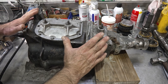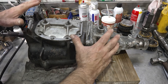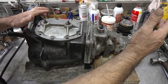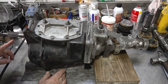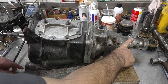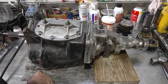What we want to do is convert this over to a late model Super T10 gear train inside using a special adapter main shaft so that we can utilize all the exact pieces of this. I'm going to change the case to a later model aluminum case but leave everything else the same so that the shifter falls exactly into place. We're going to have to change the clutch disc because it's going to be 26 spline now, and the output shaft instead of 16 spline is going to be 27 spline. Now the 16 spline output shafts have a tendency to twist - we'll see if that's twisted when we take it apart.